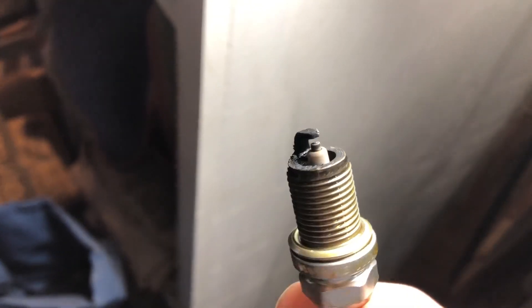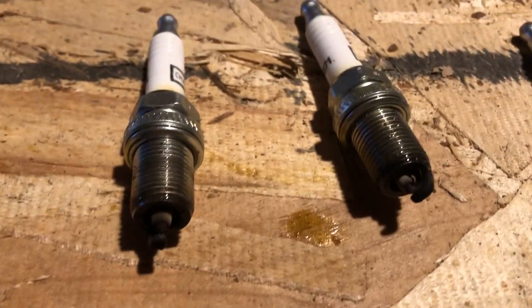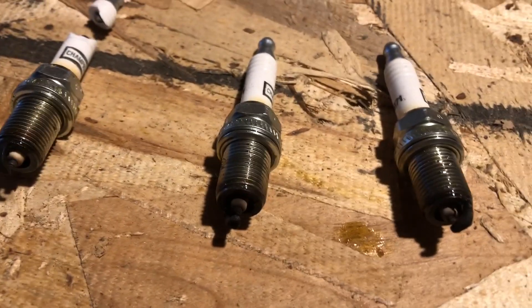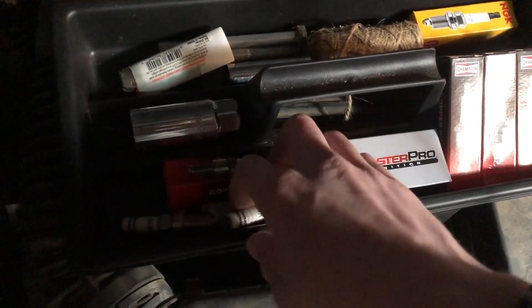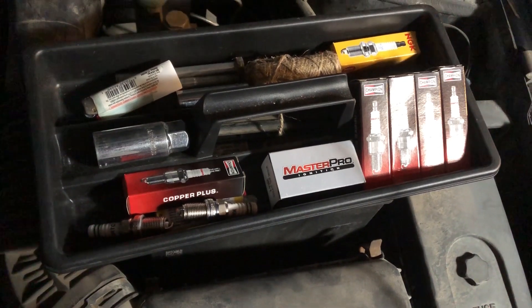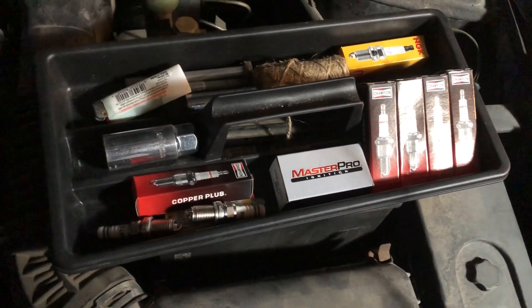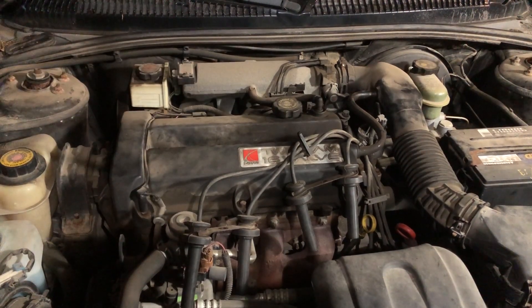We did have one casualty, but I think I'm going to replace them all anyway. Looking at one under the lamp, it's kind of charred — it could be worse, but they are kind of old. They're also covered in oil, at least the threading is; the tip must have burned the oil off. When you first start the blue Saturn up, it burns a lot of oil. Of the brand new spark plugs I have on hand, I only have two that are the right size, so I'll stick those two in, then use the Dremel brush tool to grind off some of the grime on the other two and stick them back in. I put the new ones in number one and three, and cleaned up number two and four with the Dremel to grind off some carbon.